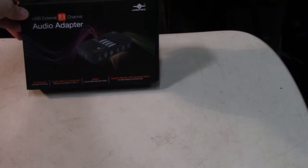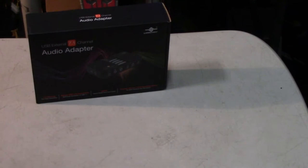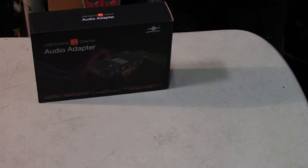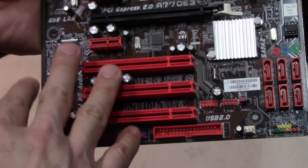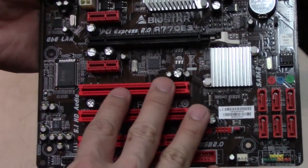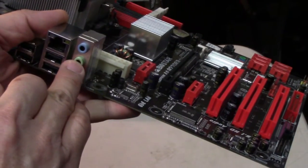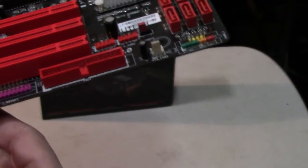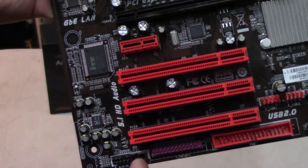Some people are more picky. If you want the cleanest sound possible, go with a DAC, because even with the best onboard audio, that audio chip shares the same PCB as the main motherboard. That means electrical noise humming through all the other components may come out your audio jack and your front panel audio jack. Newer motherboards have separated that somewhat — some even have a lit-up LED section indicating it's a separate board.